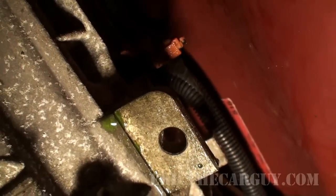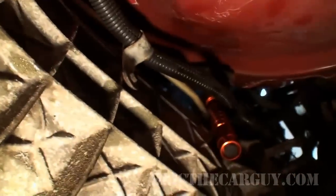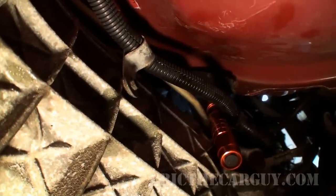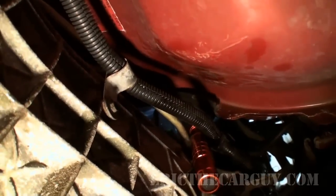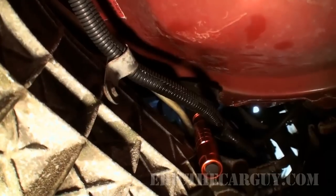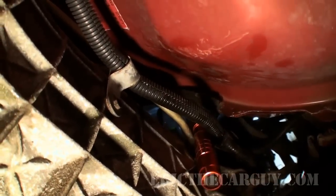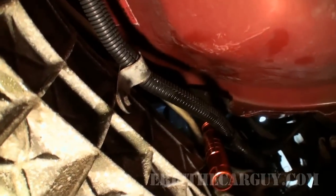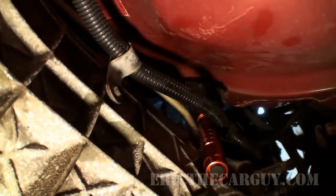I can't very well let it go like this. What I'm gonna have to do is move the stuff on the top of the engine, check the torque of the head bolts, and see where we're at from there. I'm a little bummed. I'm glad the engine runs. I'm glad the thing's cooking with gas, but this is a real setback, unfortunately. I also need to talk to Ryan's mom about this a little bit, see what she wants to do.